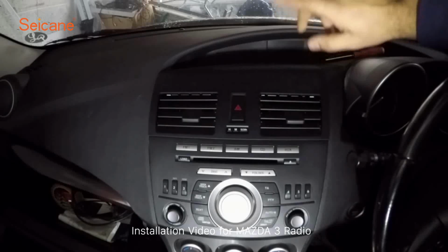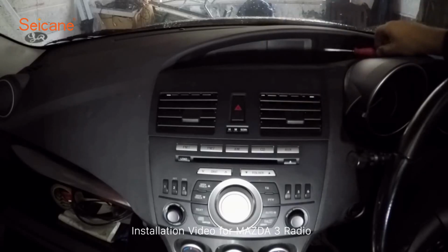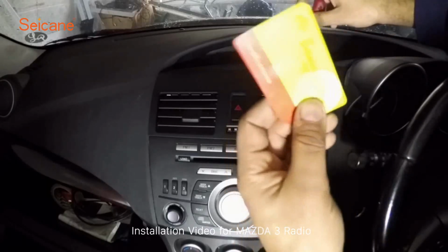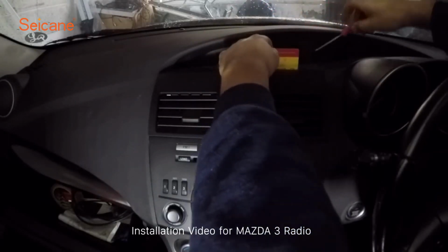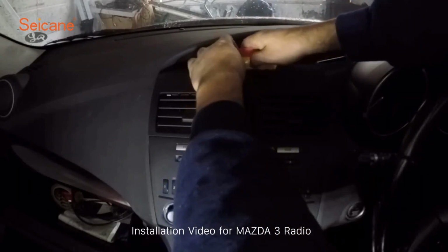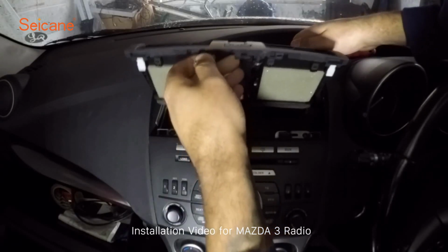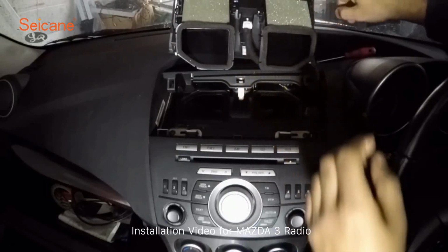So guys, first thing we've got to do to get to the unit is remove these fan vents. So what I've done was, with the thinnest screwdriver that I could find, I put it into the back of the vents and prised it a little bit. Then I used a card to put that in. Once that's in, take that out. I just slid the card along, found the center, gave it some force, and then it just pops straight out. I've got to apologize for the lighting in here, because it's very dark and dingy. So with the vents out of the way, I'm just going to leave them up here.